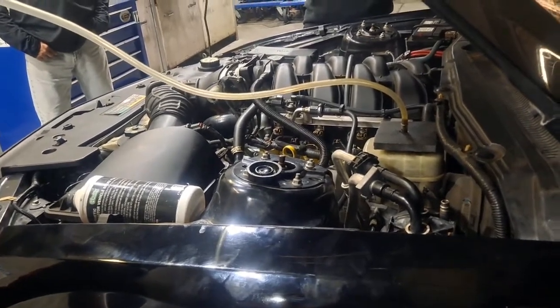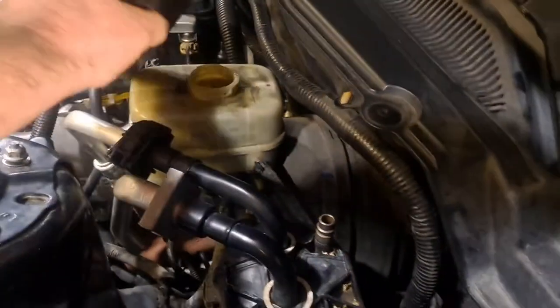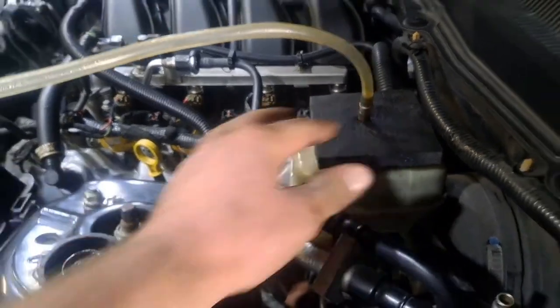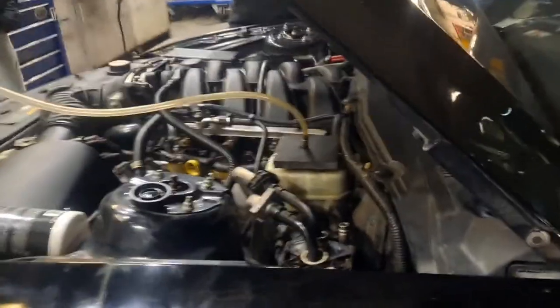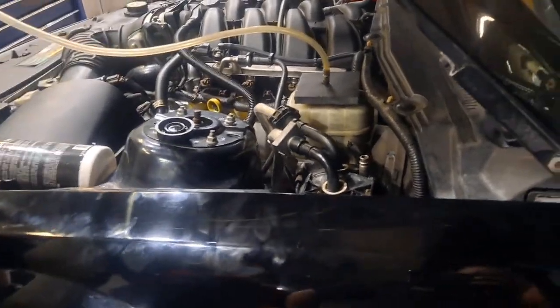About 5 minutes in. We're pulsing it, we're pumping it, we're doing a workout. And all right, ready? I'm gonna pull it, you hear the vacuum. All right, how's the pedal? I think it's there. All right, well just for good measure, we'll do it one more time. Pump up vacuum. Oh, that's good. And then you just keep on pumping. So you're probably pretty good.